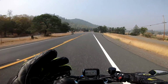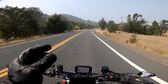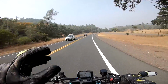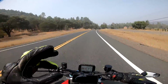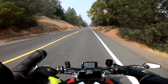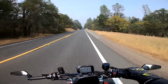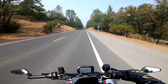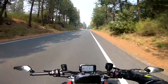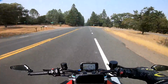The Aprilia, because the smoke is in the air, which makes the air somewhat thick, Shiv is having a problem getting it. He wants to get the air thinned out a little bit, because when we get to our normal air, like we should, the bike is going to run rich if he tunes it in these conditions. So we decided instead of picking it up, that we would leave it with him for a couple more days so we can have it for the track day at Thunder Hill. Bogna's taking that and the R3.